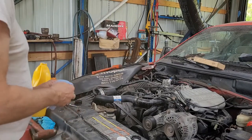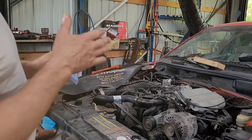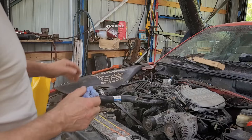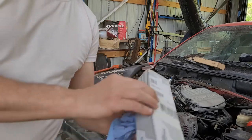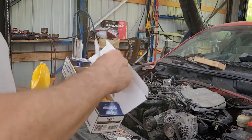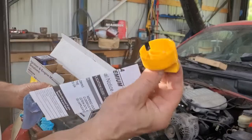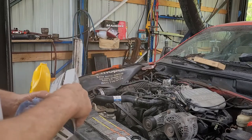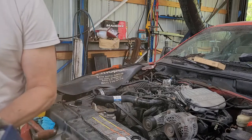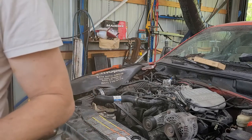As you followed me getting the pre-timing done, I matched them all up as far as what top dead center was between the two engines, and then set it like that. Then what you're supposed to do is take one of these alignment tools, pull that completely out, set the synchro to match this, and then set your timing at 26 degrees. Let me read that again, because I can't remember whether before or after. And then you stick that back down there, and then you're done.